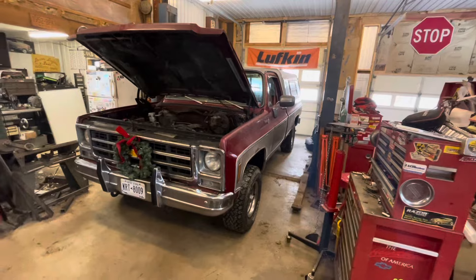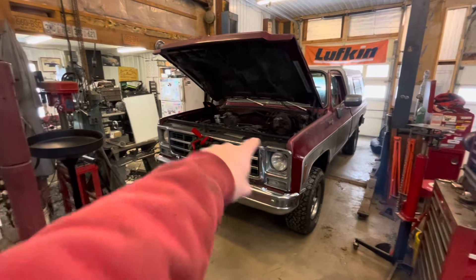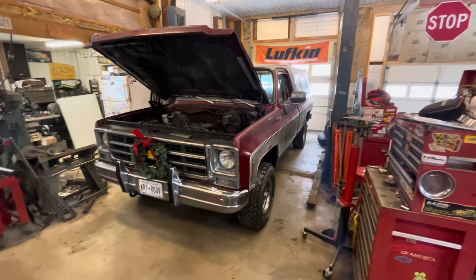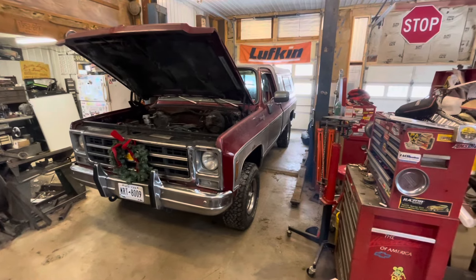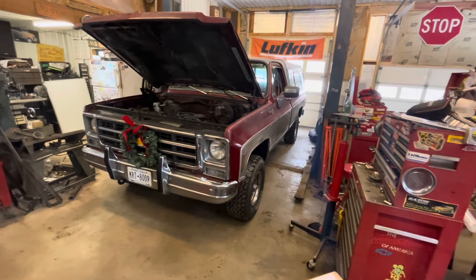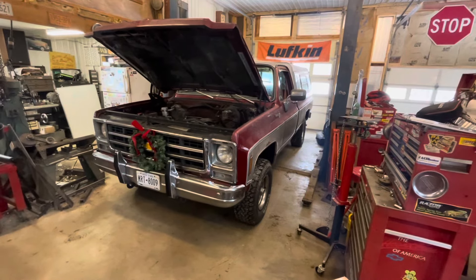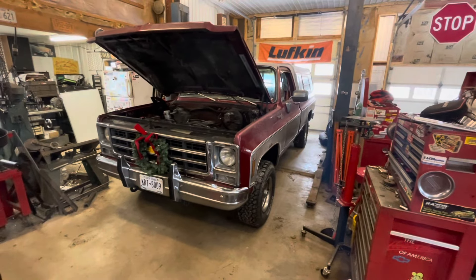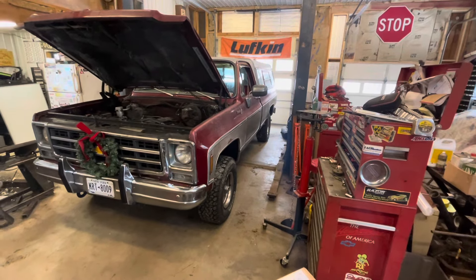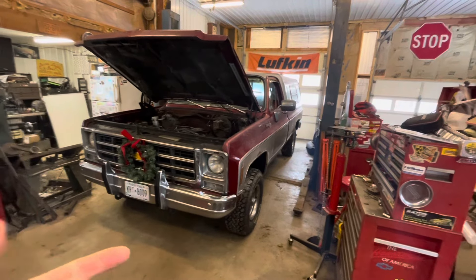When we went to Ohio, it had a really loose torque converter. Trying to tow with that loose converter was pretty much a nightmare. I put a huge transmission cooler in it — it's the size of the radiator — and that helped some, but I just couldn't tame it. A year ago wintertime, the transmission went and reverse went. So while they had the transmission out, I got a tighter torque converter from a friend and put that in, and it drives so much nicer now.